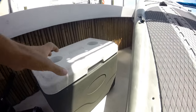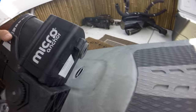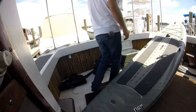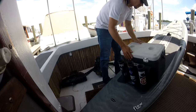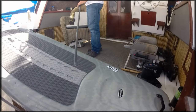Here's an old cooler I had that I was going to use as a seat, and inside is the micro-anchor, which I really wanted to attach. This is where I was going to put the micro-anchor — you can see I would have to add a scupper hole if I was going to do that. On the bottom there were scupper holes already, but they don't go all the way through and they're not centered. Their location is kind of weird too, because that's where I was going to put the cooler as a seat, and I didn't want the micro up front — I really wanted it in the back behind the cooler. There was going to have to be a hole back there big enough to accept this 5/8-inch diameter spike that PowerPole offers with the micro-anchor.